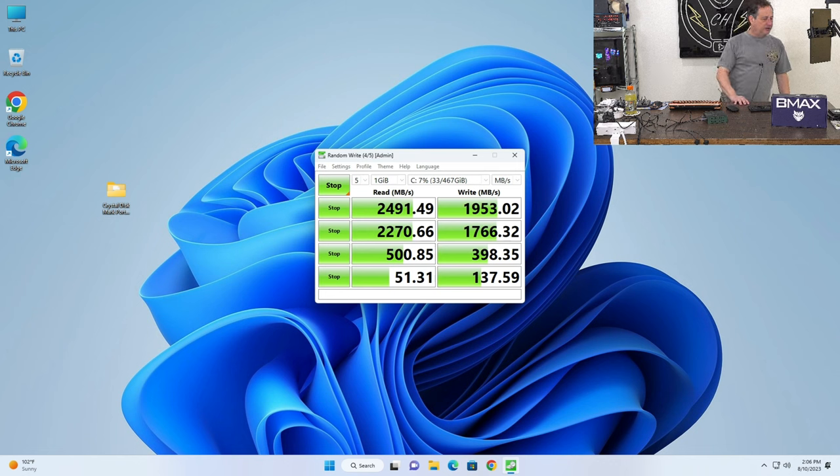Bull142 says, Carrie, check your email. V Manor says, I saw a YouTube video about how to enable TPM and secure boot out of BMAX. Oh, okay. Well, let's see what that video says. They go into trusted computing. Security device support disabled. No security device found. Okay, so they changed that to enabled. We already did that. What else do they do? Whoa, secure boot, okay. Oh, we didn't turn secure boot on, did we? In secure boot mode, they set to standard.